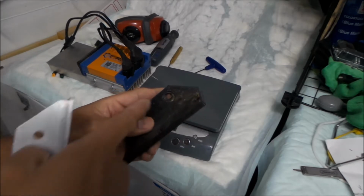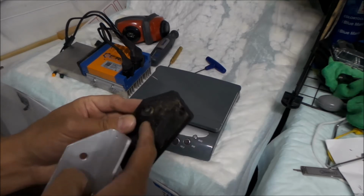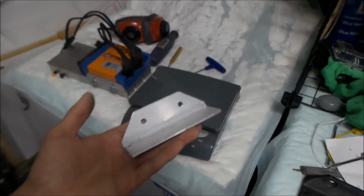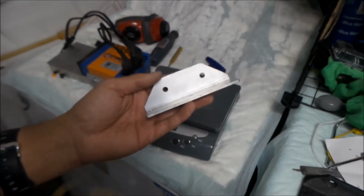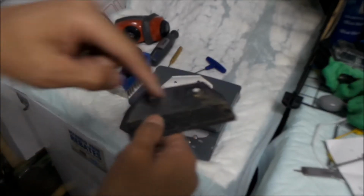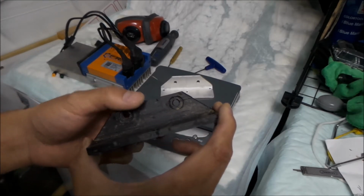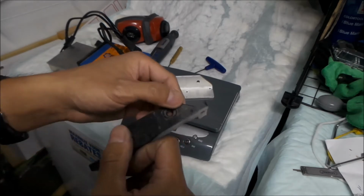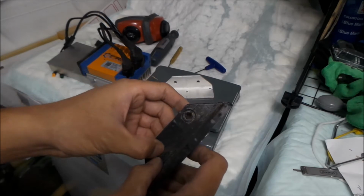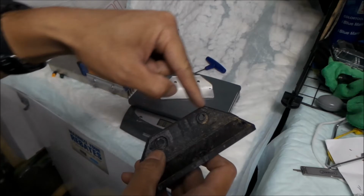It looks like I may need to add some kind of washer. Well, no, not really. I think this is too thick. That's probably why they countersunk it. Okay. So yeah, it's heavier than the ERT one, but I'm pretty sure this is probably stronger. Had this just been one mold instead of a 3D printed plastic bracket, I think it would have been much stronger. But it failed along this 3D printed pattern here. So when the printer goes like this, that's a weak point.